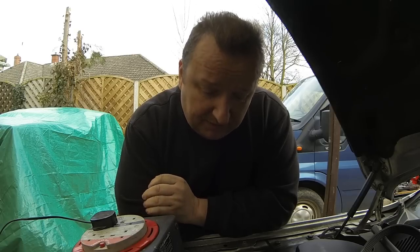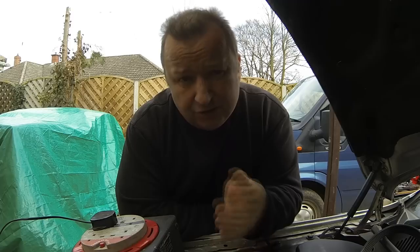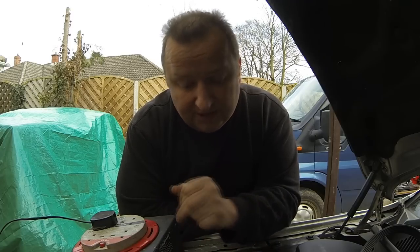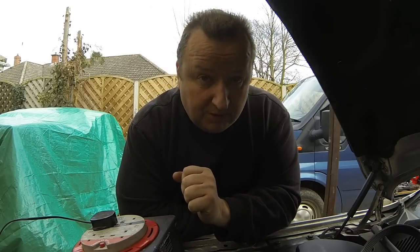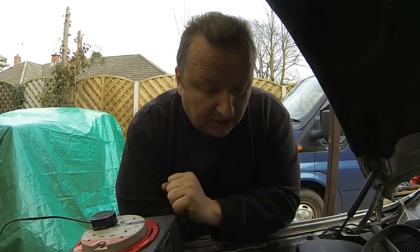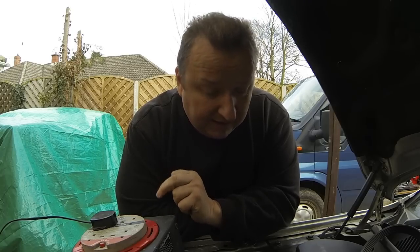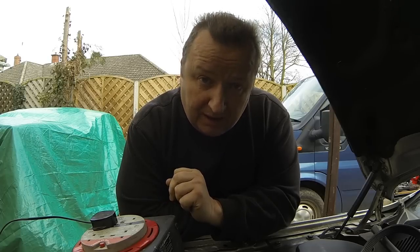And other people recommend that you actually take off the top engine mount on this side and lower the engine a little bit. I'm probably not going to do that, but that's what I may come up against, and if so, I'll have to take that off as well and hold the trolley jack under the engine just to take the weight a bit while I drop it down a little bit. So that's what we may come up against, as I said to you. So let's get underneath now and have a look at undoing this tensioner mechanism so that we can slide the belt off.